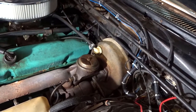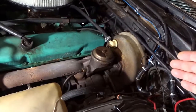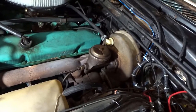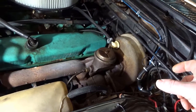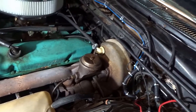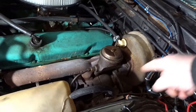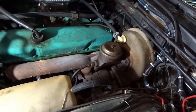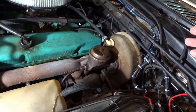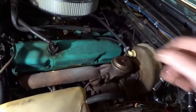Some people say you can use it. Some people say you can't because the rear drums will lock before the front discs are even half on. Some say you can put a pressure pop-off valve — about 10-12 pounds per square inch, you'll have to check that — in the line to the rear brakes, and that will balance it up a bit, because you don't want the brakes to lock at the back before the discs come on fully in an emergency stop because you may just spin round.